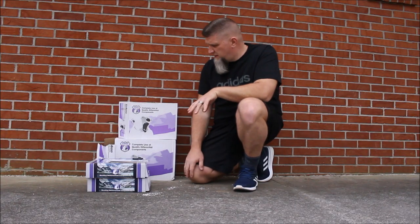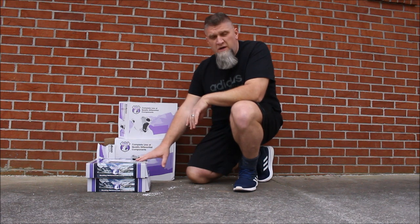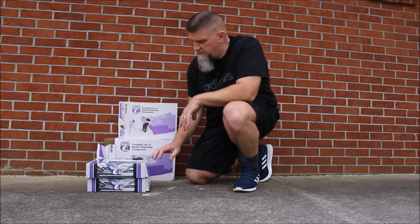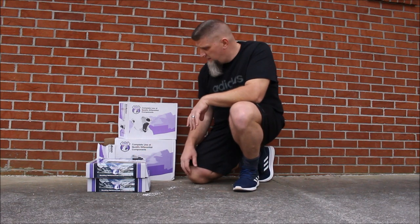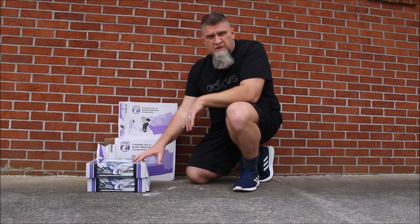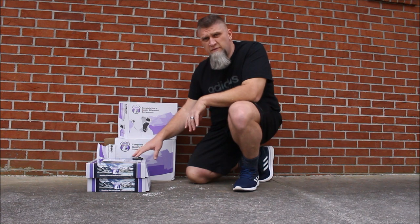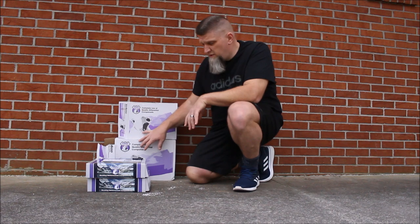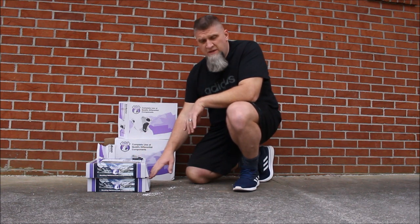So that is a quick little video to show you what comes in the kit. The part number for Yukon is YGK012 — that's the 4.56 gears for a Jeep Wrangler with a Dana 30 up front and a Dana 44 in the rear. I'll leave some part numbers and additional information down in the description below, because you may not need a complete rebuild kit — you may just want to do ring and pinion. I'll leave the part numbers for the front and rear ring and pinion only, and the part numbers for the master rebuild kits as well.